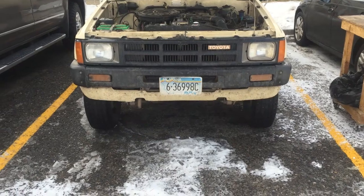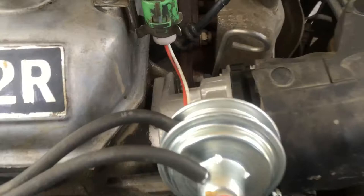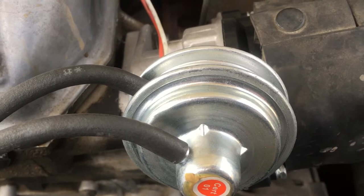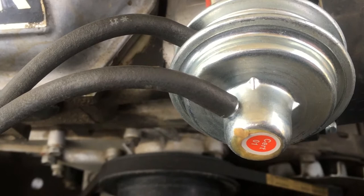Hoods up again ladies and gentlemen — it's time for a carburetor rebuild. Look at that precious shiny thing. I had this truck running good for a day and a half. I adjusted the valves, put in new spark plugs, new distributor with the vacuum advance, and now it's back to its same old bull — 30 miles an hour on overpasses in third gear. It's miserable.